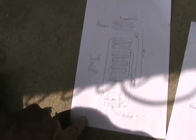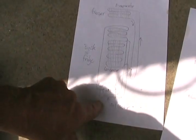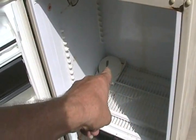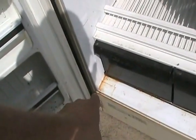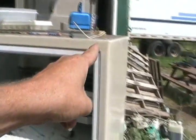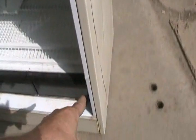There's another common kind of cooling system on a fridge that has another set of tubing, like this fridge has. When the Freon comes out the bottom of the condensing coil, you see it disappear inside the wall of the fridge. That tube would be right there on the other side of the fridge. It just runs across the outside of the fridge, then goes up close to the door frame all the way around the outside, runs along the wall, comes out, and hooks to the filter dryer.